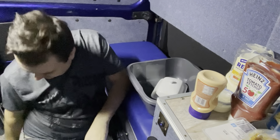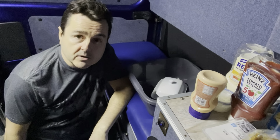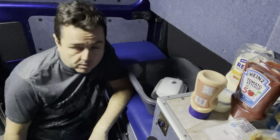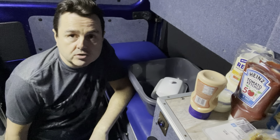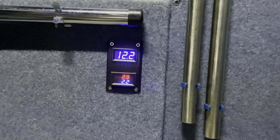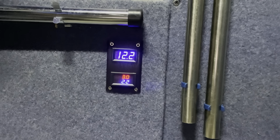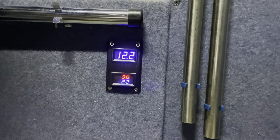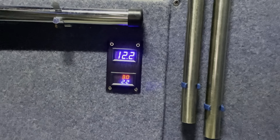Okay, so the purpose of tonight's video is to talk about batteries and just try and expose some of the myths about your leisure batteries. It won't be boring. I'll try not to be boring. But like I say, we'll just talk about leisure batteries. So the reason I showed you my voltmeter when I came in, I think it was on 12.6 or 12.7, which means that the batteries are fully charged. And I wanted to start up the heater and start up the fridge and see what it drops down to. Now the cutoff point is 12 volts and we'll discuss that shortly.